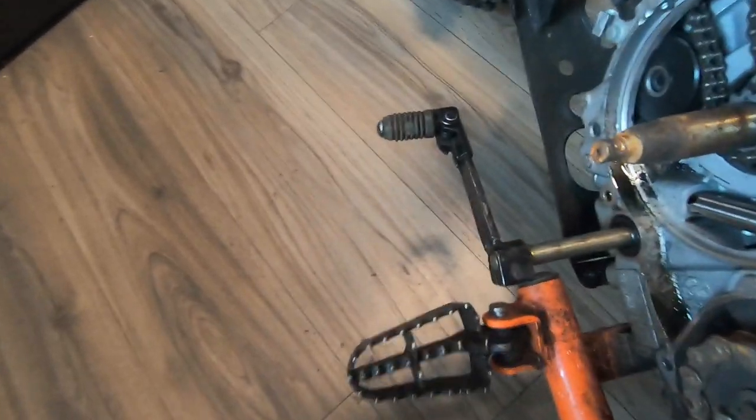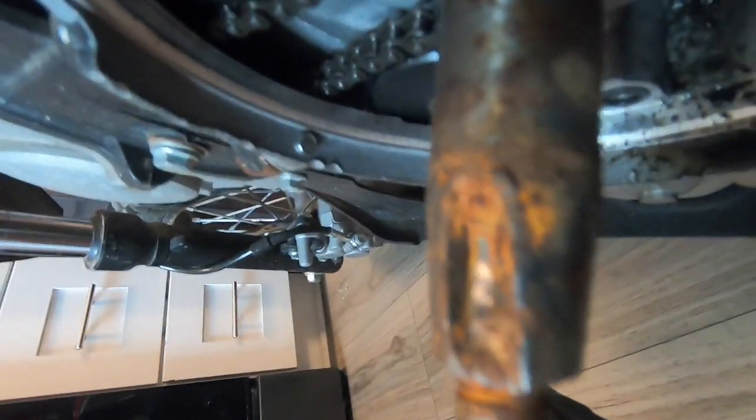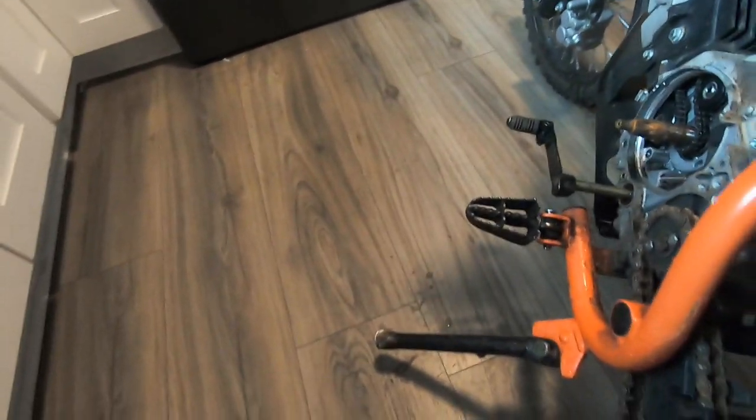The end of the crank, you pretty much screwed up. Let me see if I can turn it over. And here's the keyway. So I'm gonna have to try to fix the keyway. I'd have to replace the whole crank, but I'm gonna try to fix the keyway and the thread end of the crankshaft first. Until I get it done, I won't do anything else. So I'm starting on it.